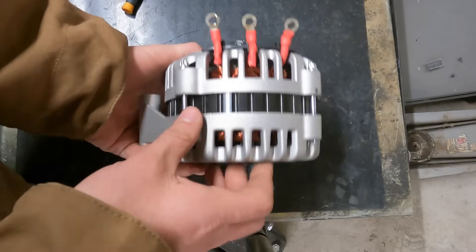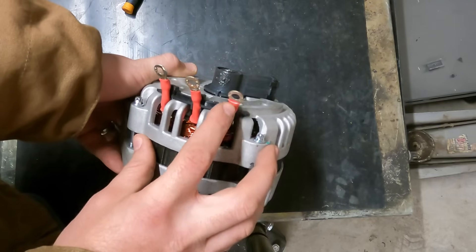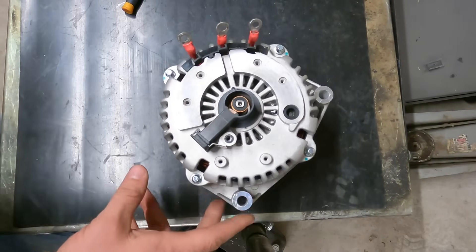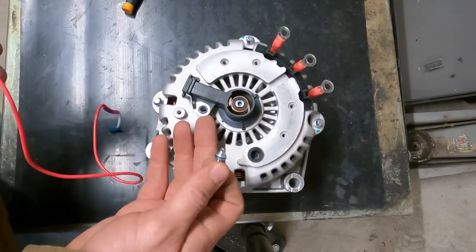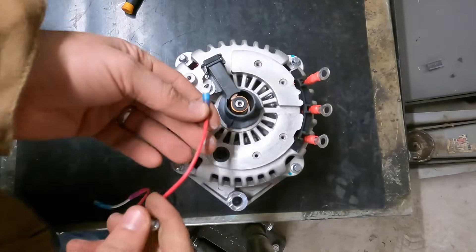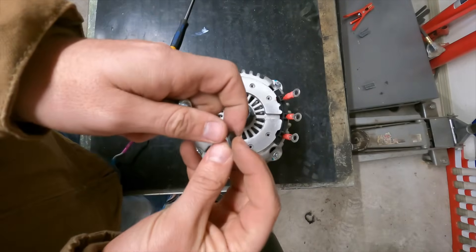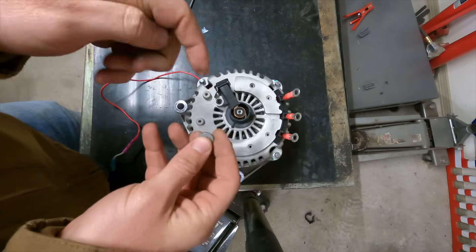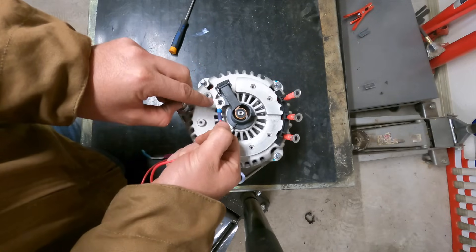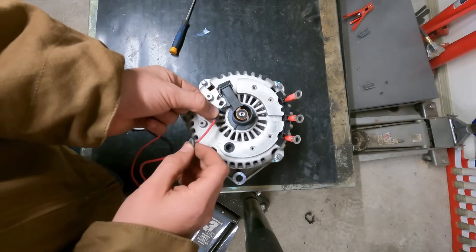From here what you need to do is clip some terminals on the end. What I did was put heat shrink over each of the stator leads coming out, just so I don't have that touching the casing. Another thing we need to do in order to be able to weld with this is hook up a wire directly to our positive brush - which is this piece right here. If we send 12 volts to that we are full-fielding the alternator. What I did was create this little wire and take our bolt that we took out, put an isolator bushing on it - made out of rubber - because this is going to be ground on the alternator and this is going to be positive. You don't want to hook up conductive metal to the positive going to a conductive bolt, otherwise we're just creating a short. So: isolator bushing, brush terminal, isolator bushing, bolt, then tighten that down.